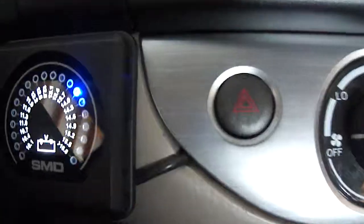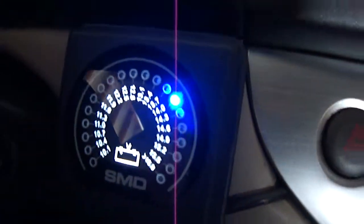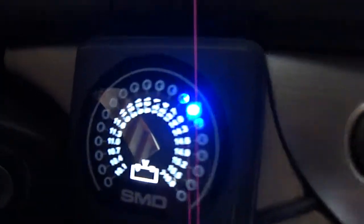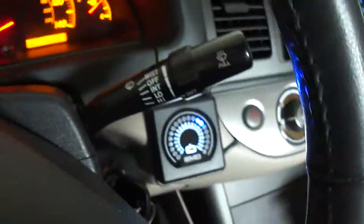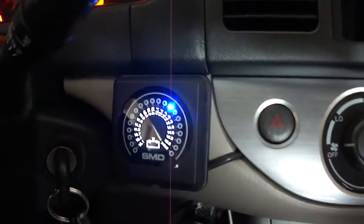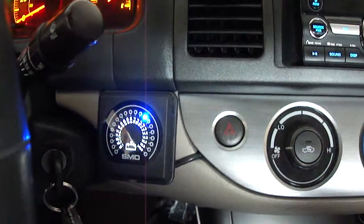Oh boy, that was loud. Just woke up a moment ago, but anyways. It's an analog voltmeter — not digital — so you'll get instantaneous readings that a digital voltmeter can't provide that fast. I think it's a nice product overall, I like it. You can see it's dropping to 13.7 now, the car is a little warm. Rev it up a little bit and it goes back up to 14. But anyways, that's it — the SMD VM-1 voltmeter. I'll see you guys later. Hope the neighbors don't kill me.